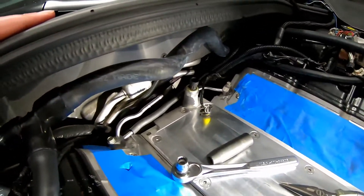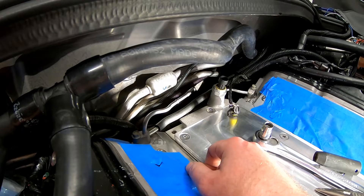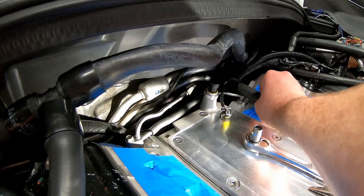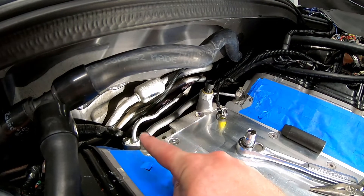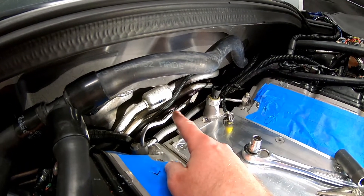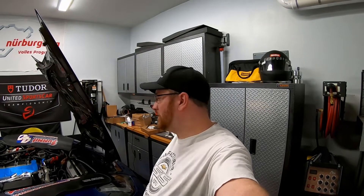Alright guys, the rear steam port has been installed. Basically all we did was take these little caps off — it's a 10-millimeter bolt, unscrew both of them. I did have to heavily modify the new unit from GM. Over here in the corner you can see that I did grind down the edge of the cap — that's so we can make sure the supercharger clears, and this is 100% clear so we should be good. You'll also notice that I did bend the steam port itself, which was originally pointed straight back. I grabbed a socket, bent it repeatedly until it's pointing to the driver's side.